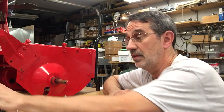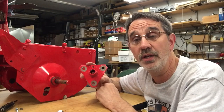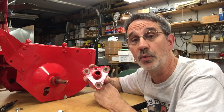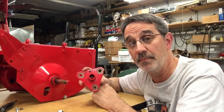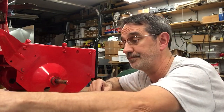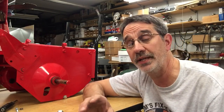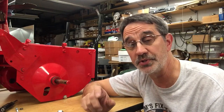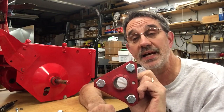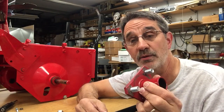But the wheel flange on the Ingersoll is just like this. Now, try to hold a 120-pound rim and tire up to try to get them bolts in. So what did I do for that? I went down and bought some half 20 stainless steel bolts an inch long, and I screwed them in from the back side. Torque them in there good. I use an impact wrench.